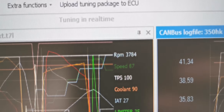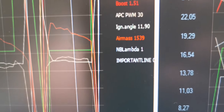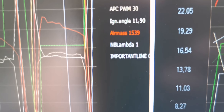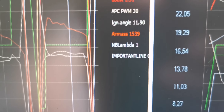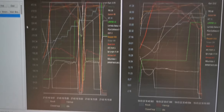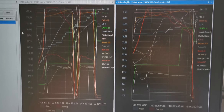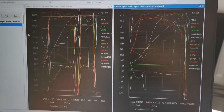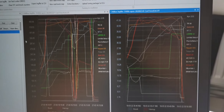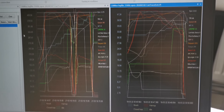And here at pretty much 3800 RPM after the modification, we have 1540 milligrams per combustion of air mass — so that's quite some difference. I hope you enjoyed this video and I will continue to do some more exhaust system modifications and back pressure testing in order to achieve perfection. Stay tuned, see ya.